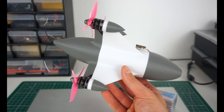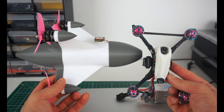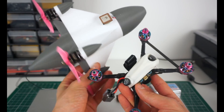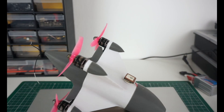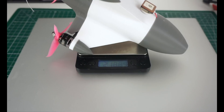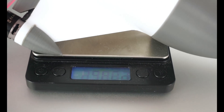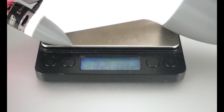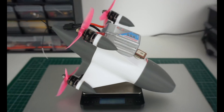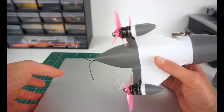One of the downsides of the design is that the whole 3D printing and aerodynamic body is actually kind of heavy. The power train is basically the same as on a 3-inch, but if you compare this with a normal 3-inch it's actually huge and pretty big. On a scale it's 218 grams without the battery; add the 550 on top and I'm at 320 grams - that's kind of heavy, about 50 grams heavier than a plain 3-inch.